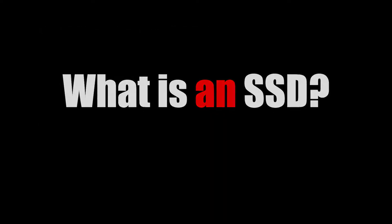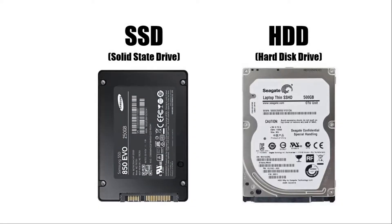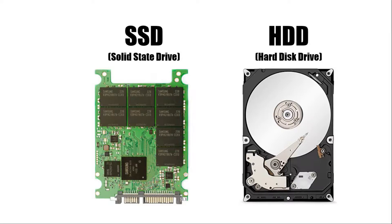So what is an SSD? SSD stands for Solid State Drive, whereas the HDD stands for hard disk drive and has been the de facto storage medium for quite some time now. The SSD has the same dimensions — 2.5 inches — and the same connecting pins as the HDD, and therefore can be replaced directly with a solid state drive. The difference between the two is because of what lies inside. A HDD is basically like those record players we had in ancient times — they are mechanical systems with rotating disks, spindles, arms and whatnot, and that is what makes them slow as well.